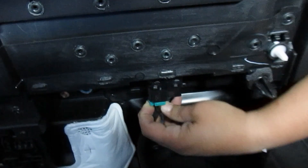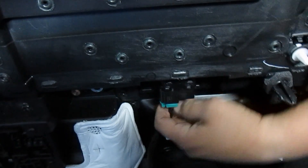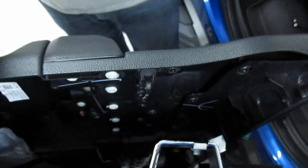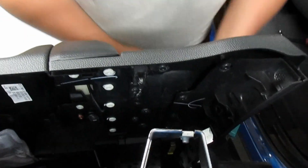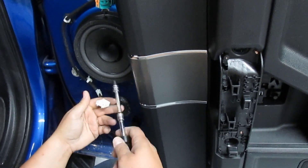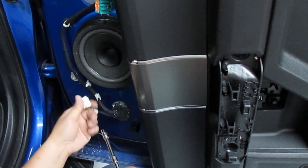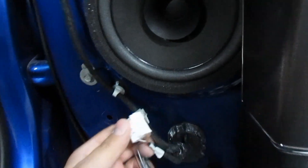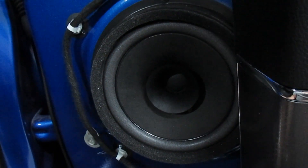Now unplug your window switch — if my fat-ass hands can do it. There we go. Then the door you can more or less just leave like that while you grab your 9/32nds again and start unscrewing the speaker. Before you unscrew the speaker, remember to unclip the factory plug. We are going to be using this factory plug because I don't like doing what those dipshits do — drilling a hole and putting in new speaker wire.